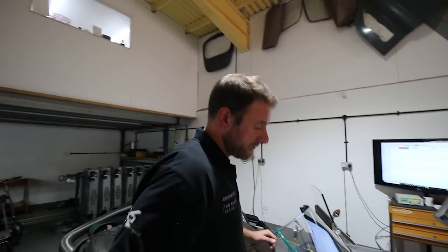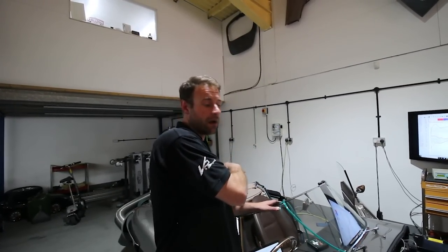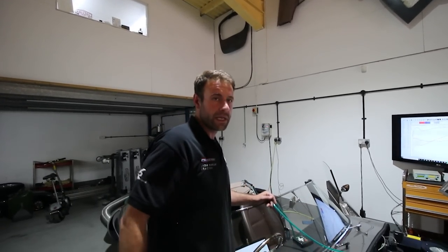Yeah, and I assume you've got, obviously, new pumps and stuff in the back. Yeah, so we've got an in-tank pump that we're running now, regulator, all that sort of stuff. We have run it on a single line going down the car, so all the regulation is in the back of the car, and it's one line coming down. No return. No, all the return is done at the back. Okay. Clever stuff.